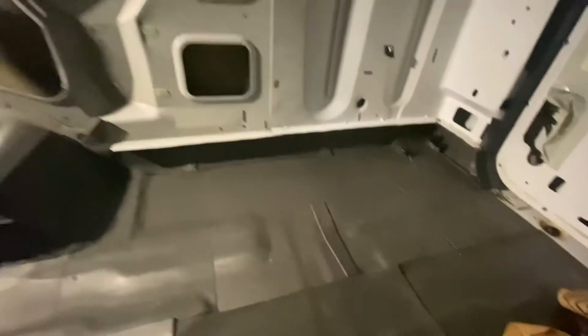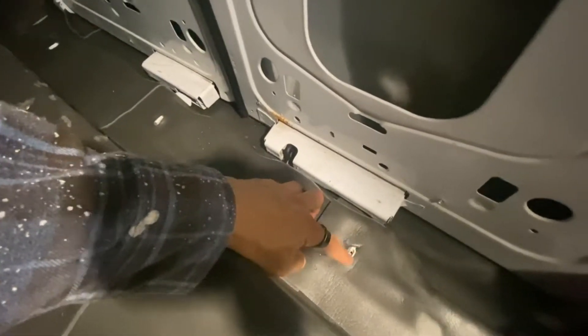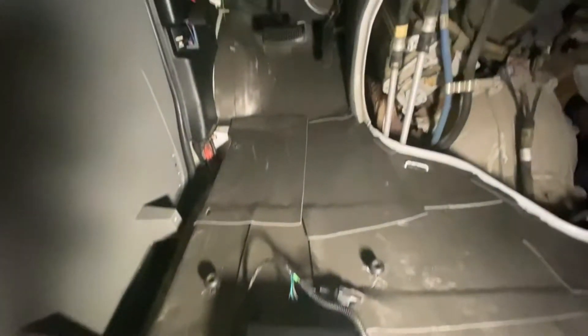This is what it looks like. I went up a few inches on this side because my subfloor is going to be covering that section, so I wanted to insulate that too. You want to cover every single crevice. The parts of the floor that need to stay exposed are where you're putting back the plastic step, and of course keep your seat mounts exposed as well. Work around everything you need to keep exposed, and you'll end up with a bit of a mess. Hope you guys enjoyed the episode, hope you learned something, and see you real soon here on JT Time.